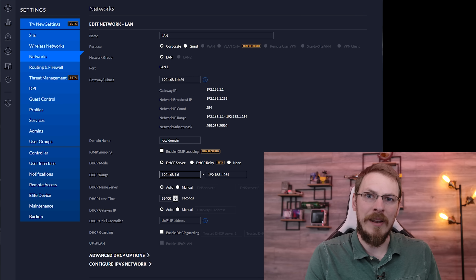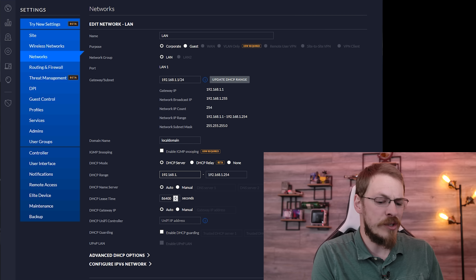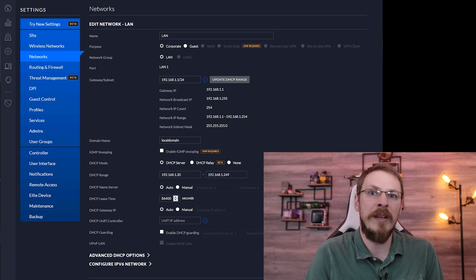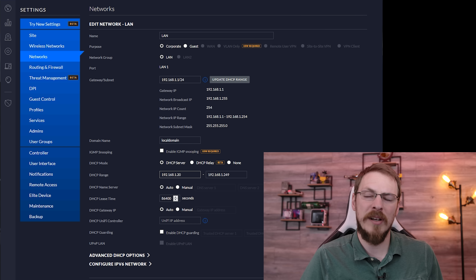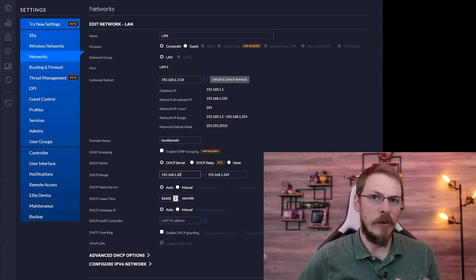The last thing is to modify the DHCP range — that is the range of IP addresses your clients can use if they connect to your Wi-Fi or plug into your home network. The default range is 192.168.1.6 through 254. I usually like to start my ranges at about .20 and end at about .249. What that means is that if a client connects via Wi-Fi or plugs into my network, they'll get an IP address between .20 and .249. However, that also allows me to manually assign addresses above and below that range — so for my Wi-Fi access points, I can give those addresses like .11 through .14, outside the normal dynamic range.